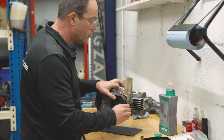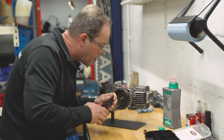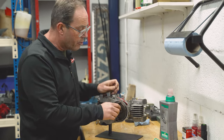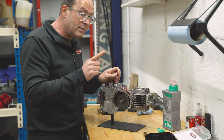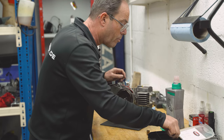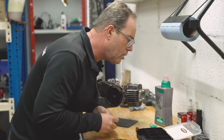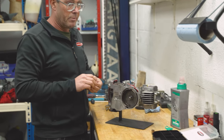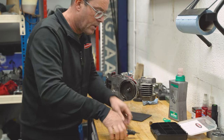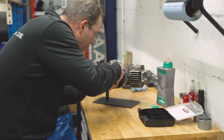This is still too much and horizontally it's also still too much. I'm going to get the clip out and put an extra shim on the front side. You can also put the shim on the back side, but that's the next episode — it all depends on the clutch you have. I'm taking the thinnest one in the box: 0.2 millimeters, the smallest one. I'll put it behind the original, then put the security clip back on.